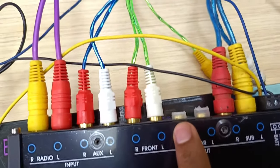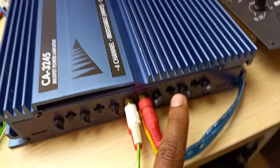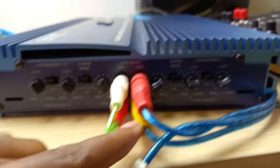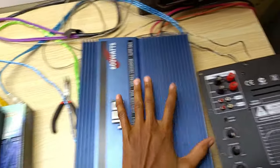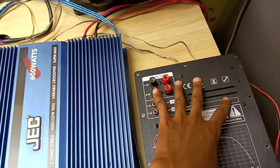For the rear channel I haven't connected cables in this demo, but normally the rear outputs go to channels three and four for mid-range. Instead, I connected the subwoofer output to channels three and four on the car audio amplifier, with two subwoofers — right and left. In reality the rear should drive mid-range speakers and the subwoofer output should go to a separate monoblock amplifier.